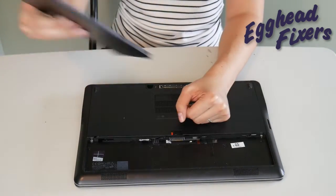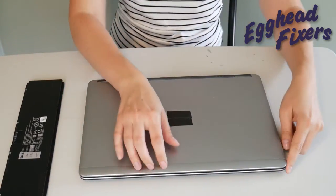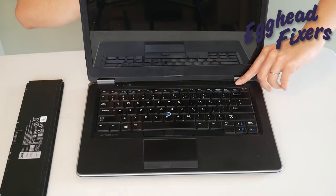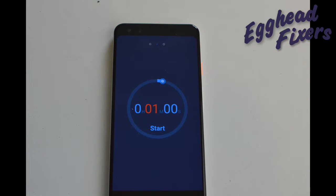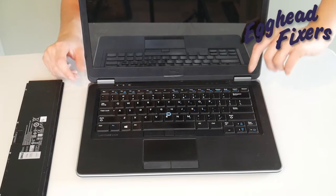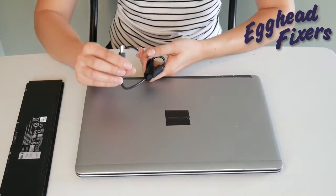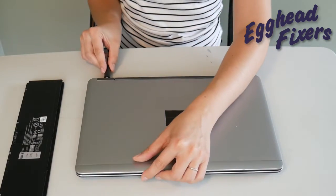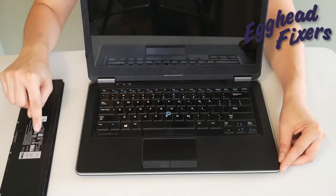Now, there's phase three to this procedure. If this doesn't work, take out the battery, unplug the power cord, and we're going to do it again, a little differently this time. We're going to hold down that power button for one whole minute like before, and then after that one whole minute, we're going to release the power button. Once you've released that power button, you're going to go ahead and plug your power cord back in. This time, we're not going to put the battery in, and we're going to try turning it on again.